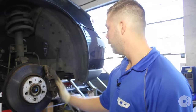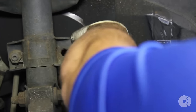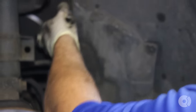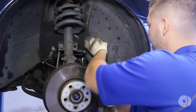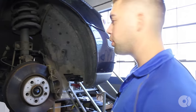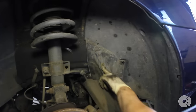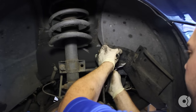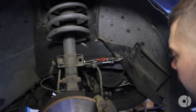We're going to lift the car, go underneath, take the wheel off and the cover, and you'll gain access to your crankshaft pulley. We got the wheel off. You're going to notice there's a handle here with plastic nuts — be careful with them. Take those two nuts off and put them to the side, and take that plate to a safe place. I'd like to use some vice grips — there's a crease already on this fender liner. Hold it right in the crease and crimp it. It's going to stay out of your way now.